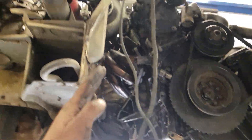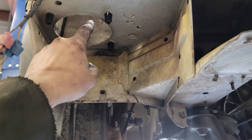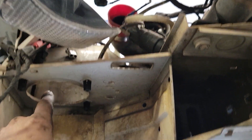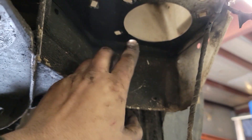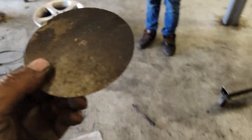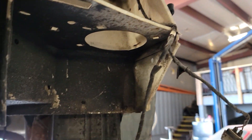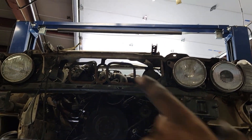It fits perfectly with that angle. This is where the AC dryer is mounted factory on the left-hand-drive car, so we have intercooler piping — a charge pipe comes down from the turbo, goes down into the intercooler, and then across. There's a delete plate on this side — there's another hole there — and on our left-hand-drive cars there's just a block-off that you can knock out. It took two seconds with a hammer, just knocked it out, and then we run the intercooler piping back up through there, up over the engine and then in.